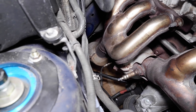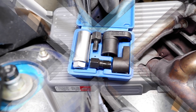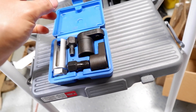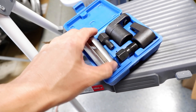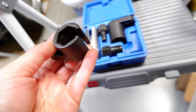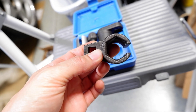Both of these sensors are difficult as hell to get to. I picked up this Amazon oxygen sensor kit — hopefully it has enough bits. There's a crowfoot one and a couple of others. I picked up this O2 removal kit from Amazon for like 20 bucks. It was actually a red box but they sent me a blue box — doesn't really matter, it's what's inside. This is your regular deep socket that you'd use if you have straight access. The one that's more accessible I'll try that first. The one against the firewall I'm going to have to use this crowfoot. I might have to put it in backwards — actually no, I have to put it in this way. Then I need a deep enough extension and a breaker bar to reach in there and break it loose from the header.